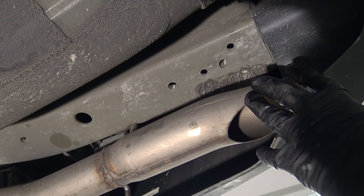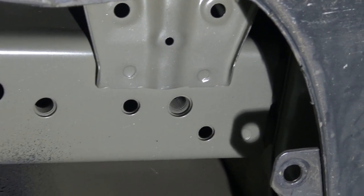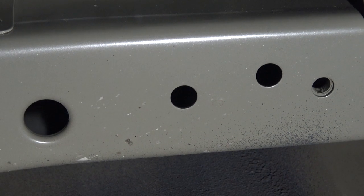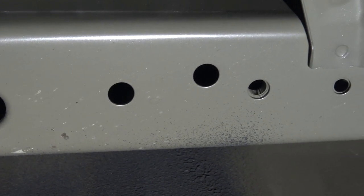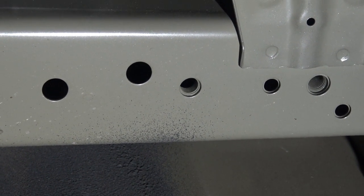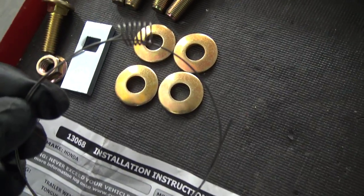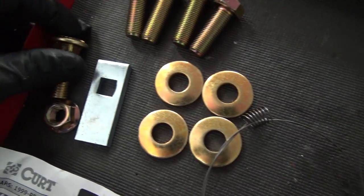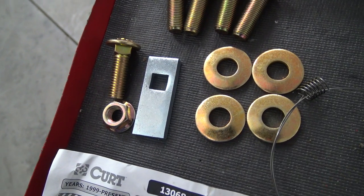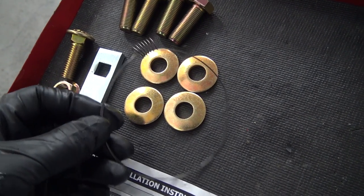Here's a look at the two mounting holes on the passenger side. Over on the driver's side, we're going to use three mounting points. Two of those already have a threaded insert in place. The third one does not, and we'll be fishing one up into there. Curt gives you a bit of fishing wire, a carriage bolt, a nut, and a carriage bolt mount — that slides through the hole and turns it into a solid mounting point. This is pretty common based on the hitches I've installed in the past, and it works really great.